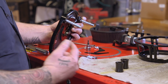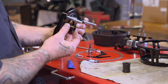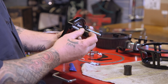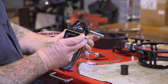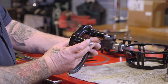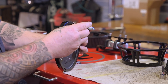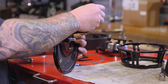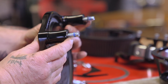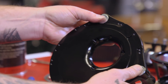So we're going to put the spacers on our breather bolts. You want to make sure that the O-ring side is facing out like this. You already have an O-ring in here sealing this side up, so you want this O-ring side facing the engine. Just slip those on there like that. And right now, while I have all this stuff sitting here, I'm going to put a little bit of blue Loctite on there. You don't need a ton. These do have torque specs and we'll get to that when we go to tighten them up, but for right now we're just going to put them on there finger tight and then line up our throttle body bolts.